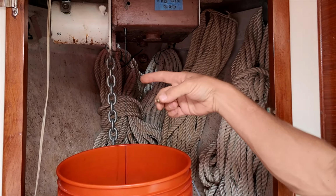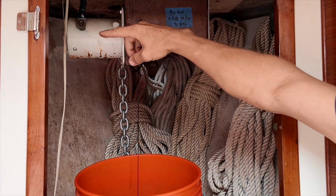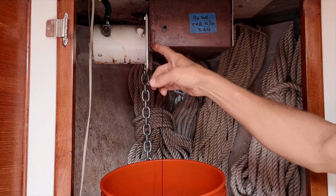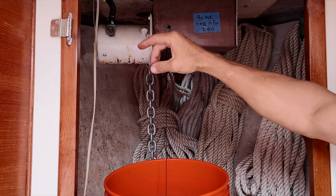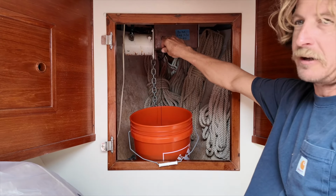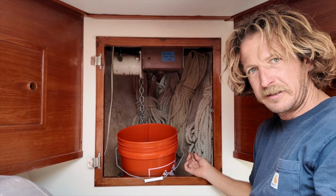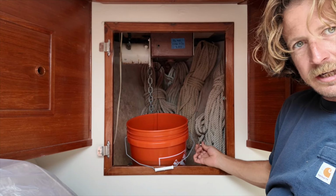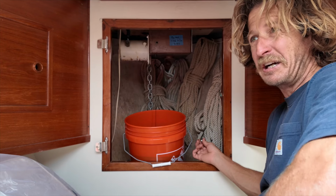Well, it was just dripping out very slowly, so I took this plug out, which I believe to be the fill level plug. So once we are done draining, we'll close up the bottom plug and then pour in the new oil from here. Ooh, that's getting full in there too. By releasing that, we released the vacuum, so it drained out way faster. And this will just be 90-weight gear oil in here. The bucket is plenty big. Okay, good. We got a couple more to do though.